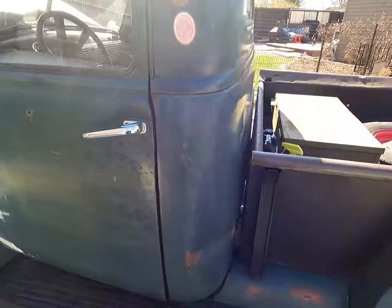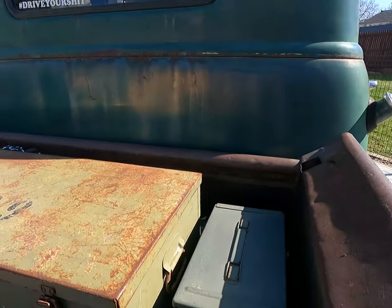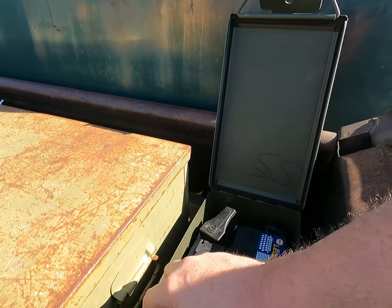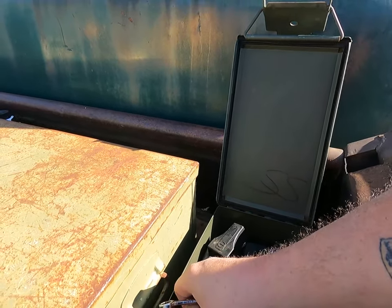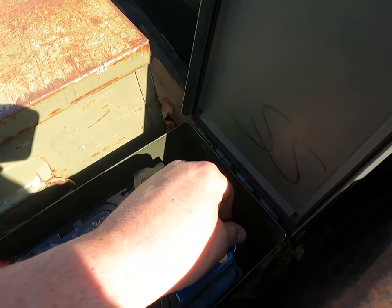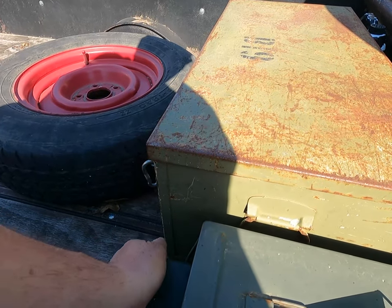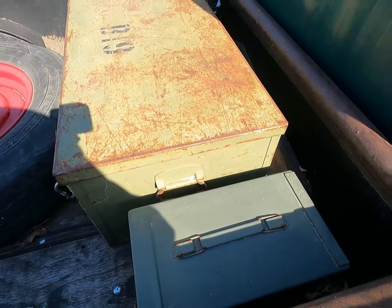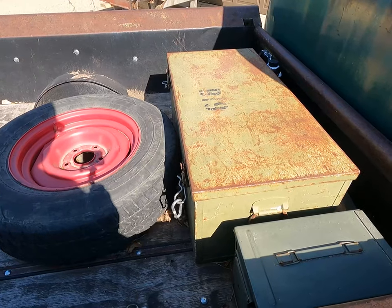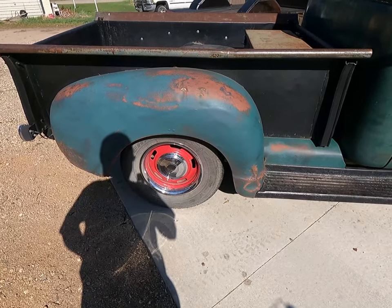The batteries were mounted under the front seat when they were six-volt and I didn't like that, so I came up with this design. This is a 50-caliber ammo can, and the battery inside is a Group 47 — for the newer Silverados and stuff. It's a vented battery so the posts are low and it fits nice and snug inside the box. It vents out the bottom so I don't have to worry about it exploding. Keeps a cover on it. I like the way it looks — it just looks like an ammo can, and nobody's going anywhere with it. We usually throw our gear and tools in the back because we drive to all the shows.